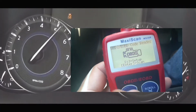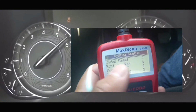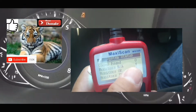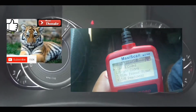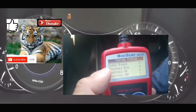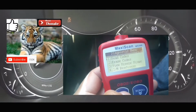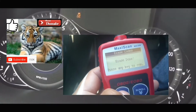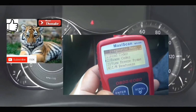And furthermore, if you take your car to get it inspected right after you did this method and the issue is still there, you're still gonna fail inspection. Reason being is that when you take it to the inspection center, they will make sure that your car goes through that drive cycle. That drive cycle meaning that the computer has checked off at least most of the sensors in your car, so that it reads out that everything in your car is working right.